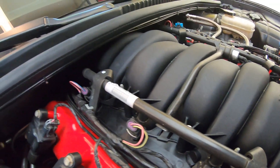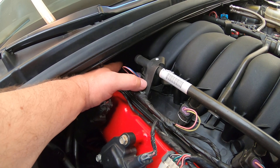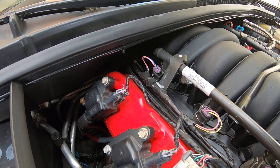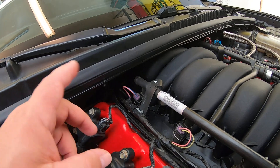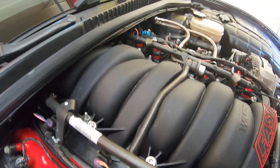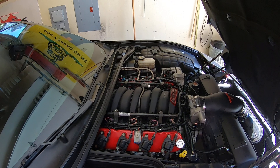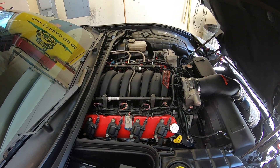If you're going to do any kind of intake work on a C5, I recommend that you cut back the plastic tubing for the HVAC controls. A lot of times it ends up getting broken, so just putting a one-foot-long piece of vacuum hose on there gives you a service loop and makes it really easy to work on. A lot of guys get carried away wanting to change their oil pressure sensor, but I still have the original one in this car — it works fine and it's not that hard to get these intake manifolds in and out if you ever need to service that.